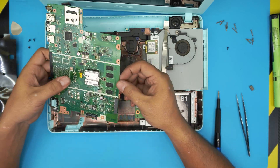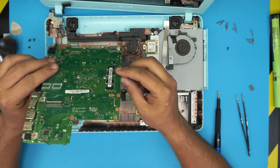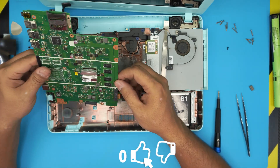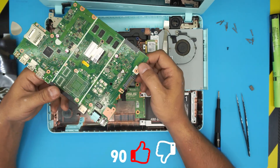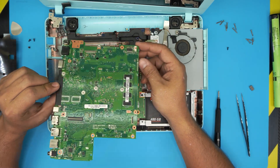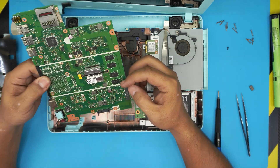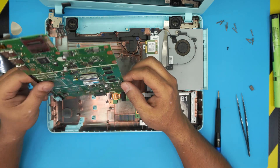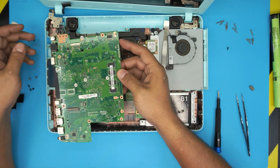And there it is — the other RAM chip is also soldered onto the board on the other side. So as you can see, it is hopeless to upgrade the RAM on these versions. The RAM is not upgradable — there is no RAM DIMM slot or anything like that available. That's the answer to what you've all been asking.